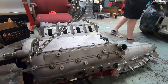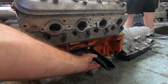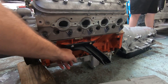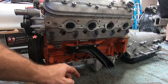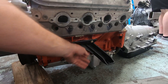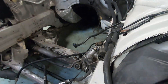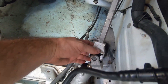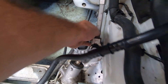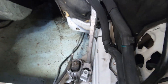When you're getting ready to put this motor in, one thing you want to do is make sure that when you put your motor mounts on here, you leave them loose enough where they can slide — that way you have some adjustability in the car. Go ahead and put all eight bolts in just snug. Most likely the motor is going to be in the far forward position, but it's a lot easier to get everything in if you leave them loose. Also go ahead and pull the steering shaft off — there's one bolt in here, sometimes it's a little tight because of the splines, go ahead and pry that off. You can tuck it up on the side or just leave it down here out of the way.